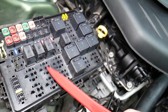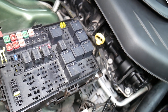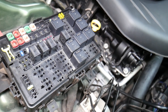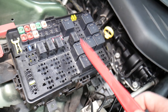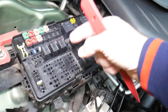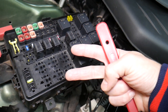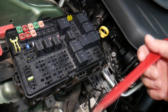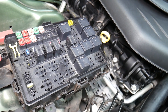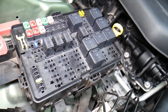For certain fuses it's important to disconnect the car battery when removing them — otherwise you can burn the electronics. For airbag fuses, you need to wait at least one hour after disconnecting the battery, and if you're not qualified and certified to work on the airbag system, I never recommend doing that. Also, a common mistake when disconnecting the battery is not knowing which terminal to disconnect and reconnect first — doing it the wrong way can burn electronic modules. We actually burned a traction control module on a BMW that cost $2,000. We'll put a link in the description on which battery terminal to disconnect first.